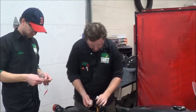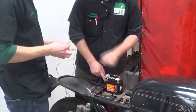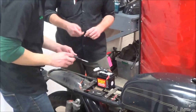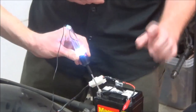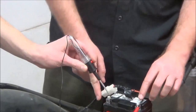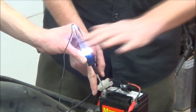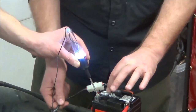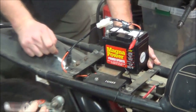You can see here it's kind of a cool little quick connect. We're just going to start off by getting an idea of how the test light lights and what it will look like on the battery itself. So you can kind of see the light there. Here's what you do: you're going to leave it on the positive. Leave that hooked up there. And now when you switch this with no key on or anything and you just start to switch around the motorcycle to different spots, it's going to test the integrity of the ground wire on the bike. Go ahead and just start testing different spots. Pretty good ground? Yeah, looks good.